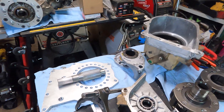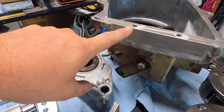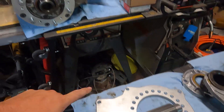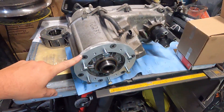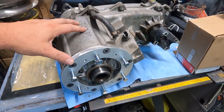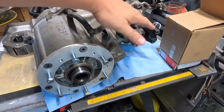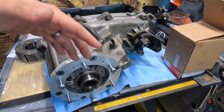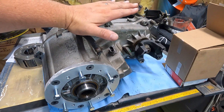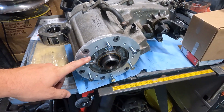So real quick, the kit that I bought came with this aluminum plate, threaded. This plate, a chromoly shaft, and a clocking ring. I need this clocking ring because of the extra length of the drivetrain. That second transfer case is going to push this driveshaft back. So in order to prevent my driveshaft from hitting the crossmember, I'm gonna have to clock this T-case up a little bit to give me enough clearance. The clocking ring is installed.